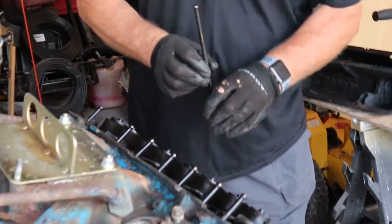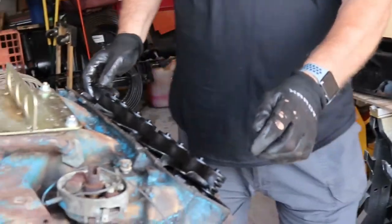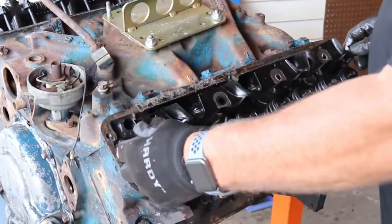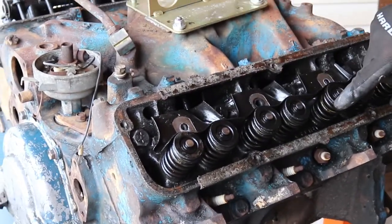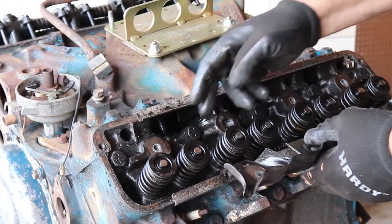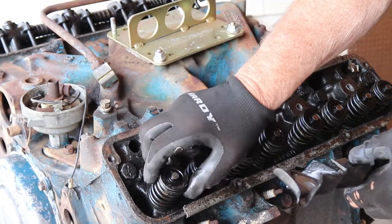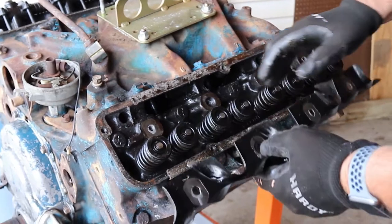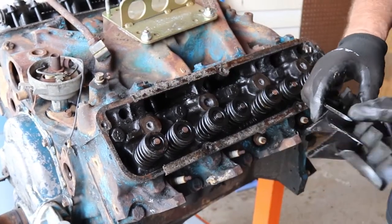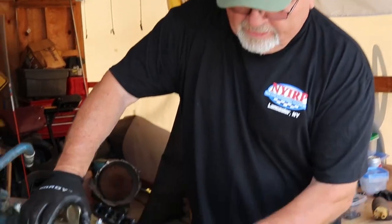Here are the push rods — these are nice and clean too. This motor has a drip tray. What they use it for is to keep the oil from splashing onto the valves, because sometimes these valve seals get old and brittle and hard and the oil sucks in and it burns oil. So they put a drip tray to keep the oil off and keep it from getting excessively nasty. You've got to take this old baby out.